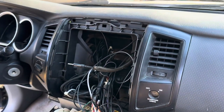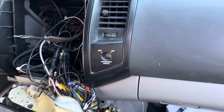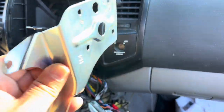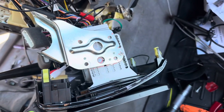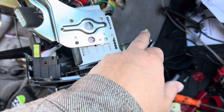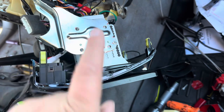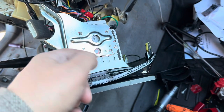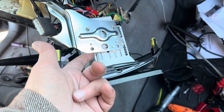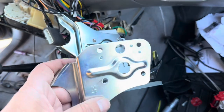Here's a nugget for this install - I see a lot of guys online using just the clip holes with press-in clips to hold it in place, but I can't get it to stay in there - it wants to spring back out of the hole. Unless you use the original brackets that were bolted in on the original radio, I don't know how you keep it in there. The bad news is these brackets don't line up with any of the holes on the side of this radio. My solution: the pegs keep it from moving up and down, and I put a rivet in here so when I bolt this bracket in, that's going to keep the radio in the dash. This side barely has a little lip - I don't even have enough to put a rivet down here, so really that's the only place I can get a rivet in with enough material.